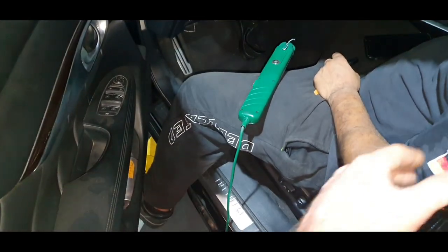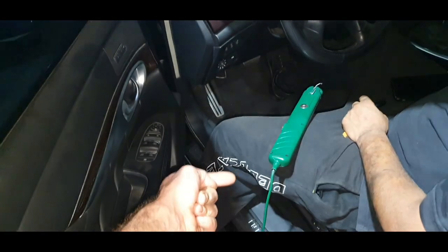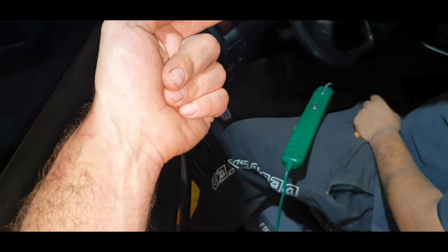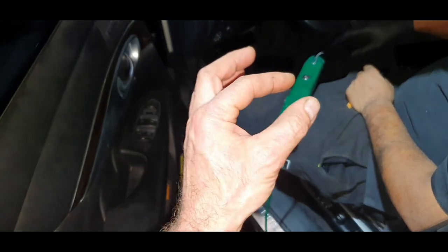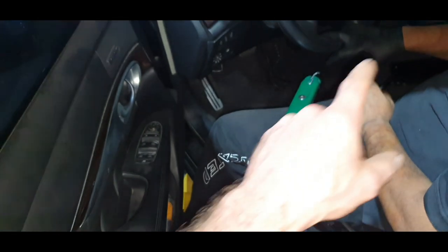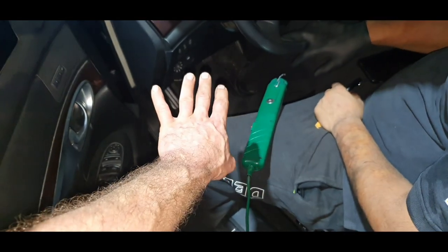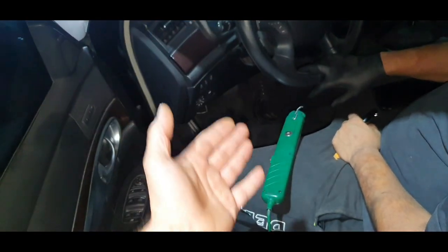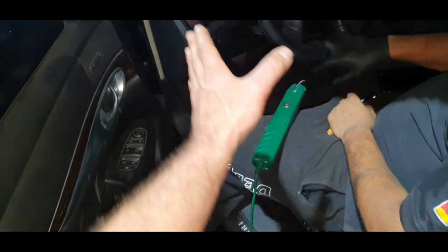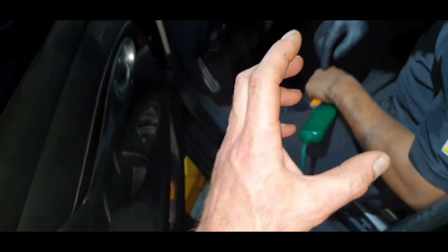Before it was fine. No, then he changed from 8.5 inches. He went to 10 inches. Yeah, but if the thickness of the clutch is more, you know the point? You're not going to disengage. What happened yesterday? He was putting the full clutch, all right, first gear in. When you accelerate and you're more than 4,500 RPM, the car starts moving. There is no weight on the pressure plate.